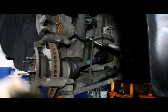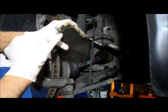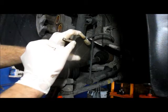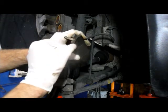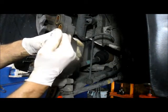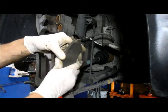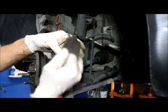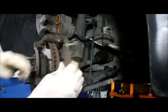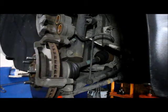I want to mention to you — this piece here is a disc indicator. When this piece comes down to where it's even with the brake pad, that's when you get that squealing noise. That's the indicator. When that comes in contact with the rotor, that's what gives you the squealing noise. And we have to put the brake pads back in in the same position that you took them out.